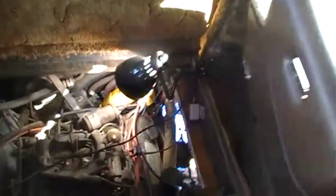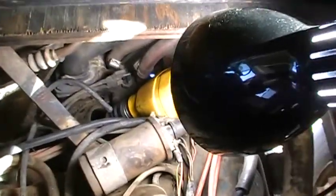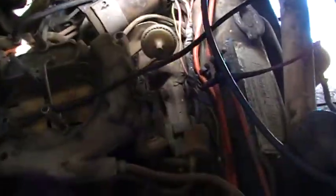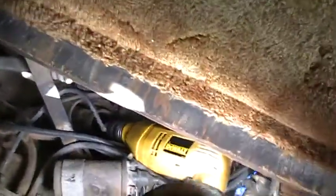Anyway, here's the heart of the beast. I've taken the drive gear and distributor out, and I put an oil drive priming rod in. With my half-inch drill I was able to get that on there, and the goal is to circulate some fresh oil in there.